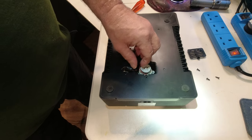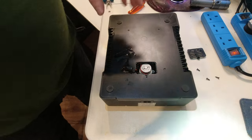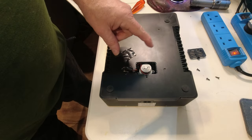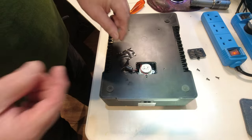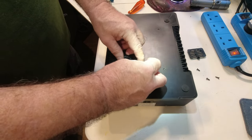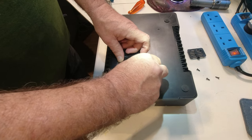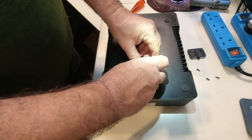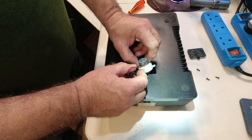And if you'd be quite gentle, you've got to move it around to get it in this, but the bevel gear on the end is quite a loose fit. It's only held on by the tension of the oil. It's not a hard push fit or anything. So as we pull that out, be quite gentle, or you might find it might detach itself.